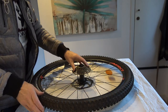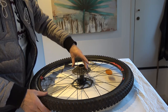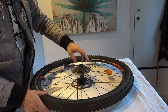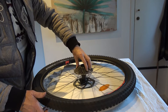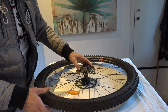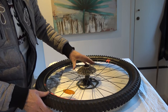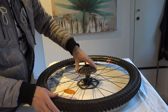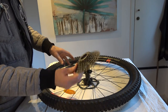Not a bad bike, but after some time the freewheel started to fail. You can hear it turn — in the freewheel direction, if you start to pedal, it locks into place and the wheel starts to turn. But in my case, after four years the freewheel gave way. It started to jump over, and if you really put force on it, it would just freewheel in the wrong direction.